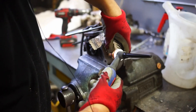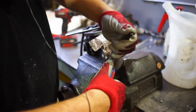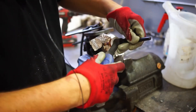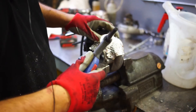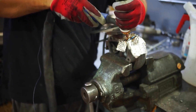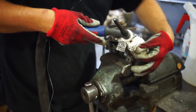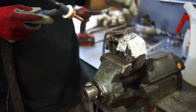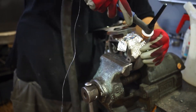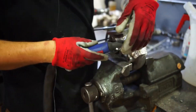This means the longer you can retain heat within the components or within the exhaust gas until it reaches the turbo, the faster you can spool. This will only make a difference of 100 to 200 RPMs, but it also means that when you run an engine that has been allowed to cool down for a relatively long time before a pull, it will have a slower response — for example in between shifts or even when first spooling — compared to when it's already been driven hard.